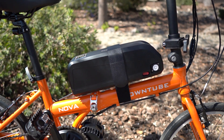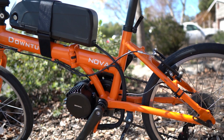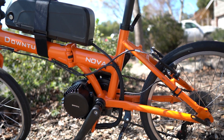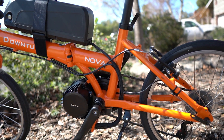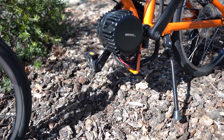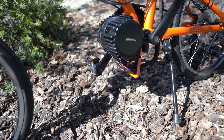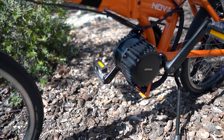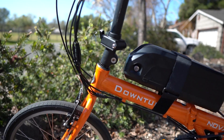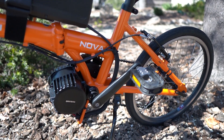You can see that big shark-style battery taking up a lot of space, but being a folding bike it's still really easy to stand over. I like to place some wire management wrapping around those connections coming up there because it cleans up the look. With this particular bike I used the underside — where there's a little support bracket for when it's folded — to bundle and protect all the wires, cleaning up the rest of the bike by following the cable all the way down without putting any pressure on it to affect shifting or braking.